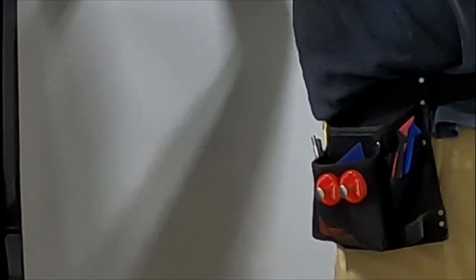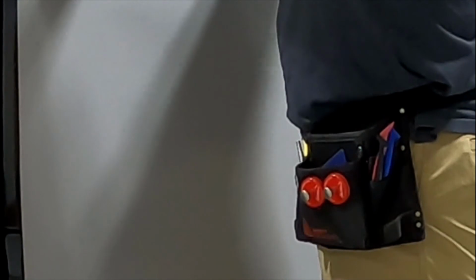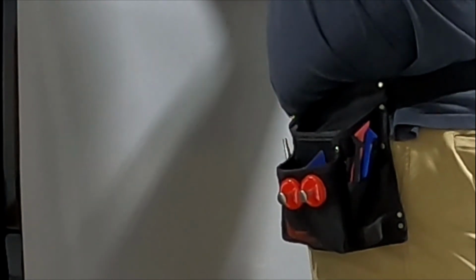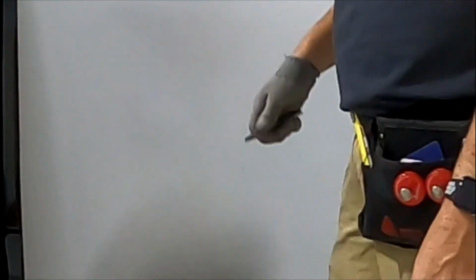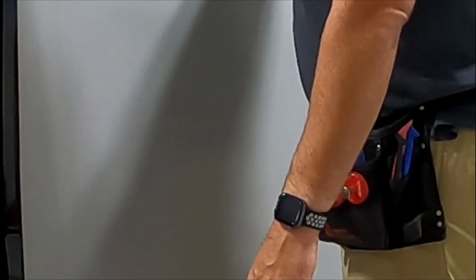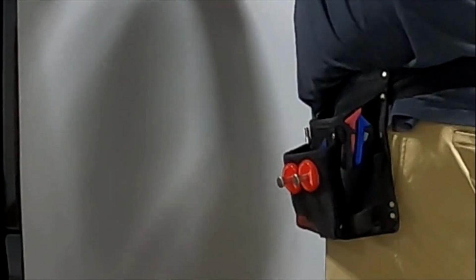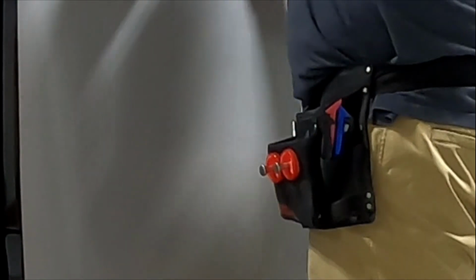You can see here, it ends literally just right here. So I'll take a knife and bring my relief cut even further in. From there, pretty much there's no more tension in that corner. So that corner is fully set, very little tension, if any, in it. And I'm going to work on down here. I'm just feeding it into that groove.